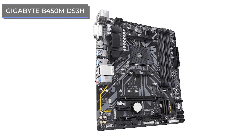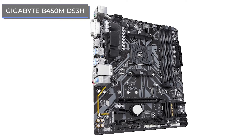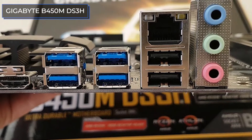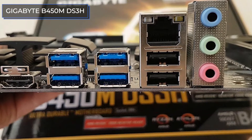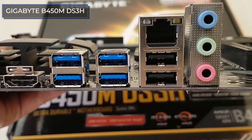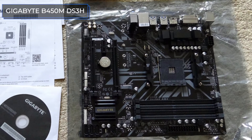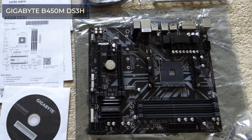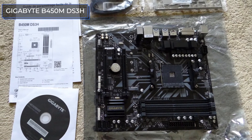There are two PCI Express X16 slots, meaning the motherboard is capable of supporting two video cards. The scalability of the video system is provided by Crossfire technology. The board has a standard set of ports: DVI-D, HDMI, and RJ45 LAN socket, plus three connectors of the built-in Realtek audio board with the same ALC892 codec as the previous board. There is also an M.2 slot located immediately above the first video card slot. Thanks to the RGB Fusion function, there is support for RGB LED strips in seven colors.